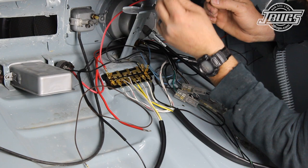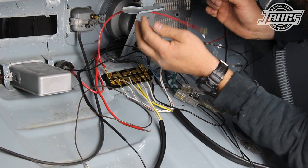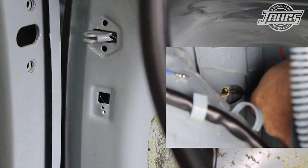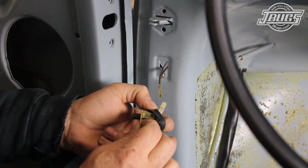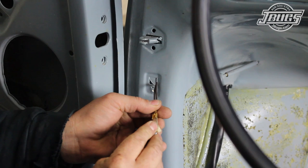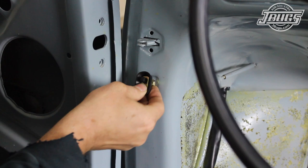The pigtail ends of the black and red wires will plug into the turn signal relay in a moment. The long end of the black wire will plug into the wiper switch. At the door jams, the brown and white wire ends are fed through the door jam openings. Then inside the car at the door jams, new dome light switches are fitted with new seals. The wires are plugged into the switches, which are set into place and held with a screw.